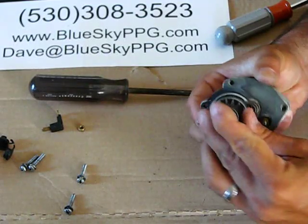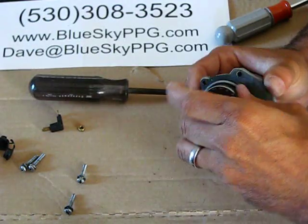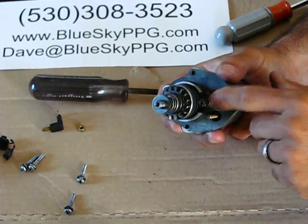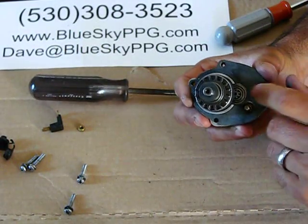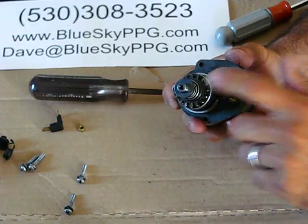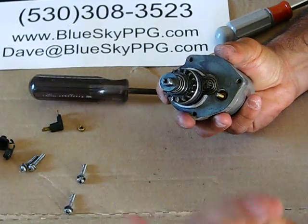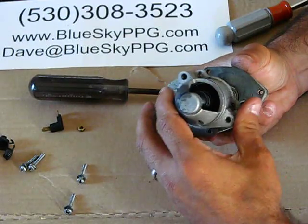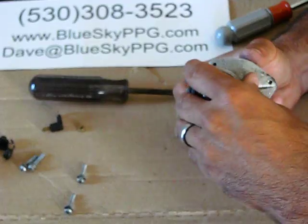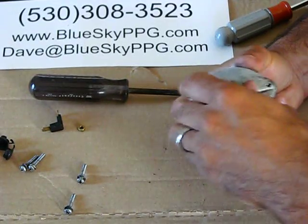I can put the Bendix gear right onto there, rotate it around, make sure that it freely spins and that the motor spins, because your motor could be seized too. There are other problems, there's bearings in there and stuff that can go bad, but the most common is the Bendix gear. All right, take your old housing, put the old housing over the top, rotate it around until the positive post feeds through, and just kind of seat it down.